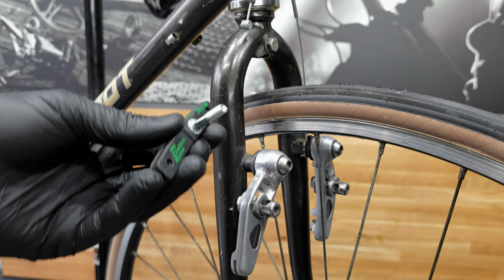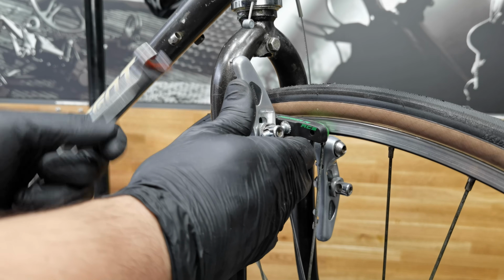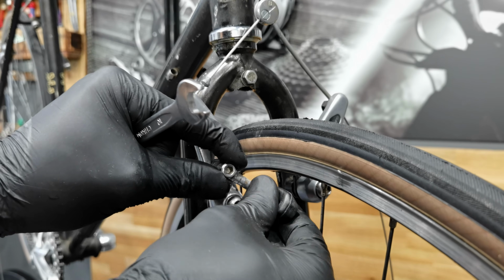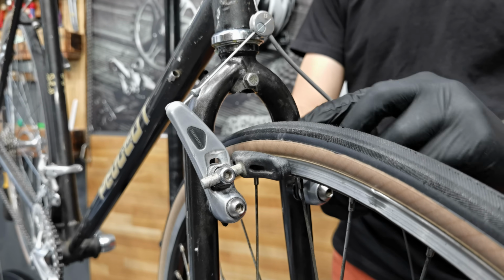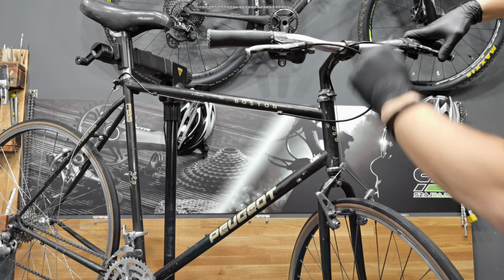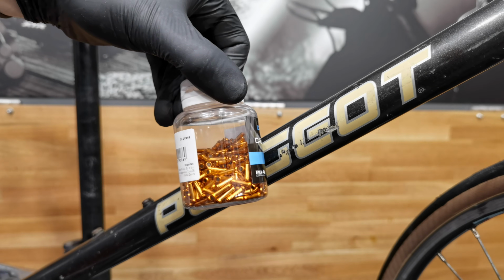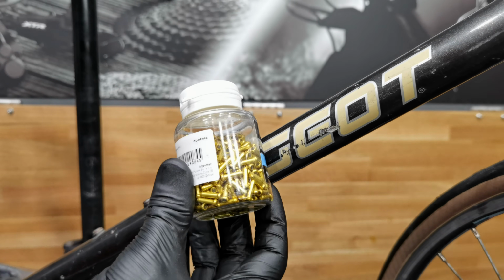And here I was just trying to figure out whether we could use those modern type V-brake braking pads on the cantilevers. The pivots on those are thinner, and I was not feeling good about how these cantilevers would hold them, so I went back to the old ones. Which color would you choose for our cables? For this frame, I went for this one.